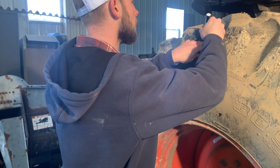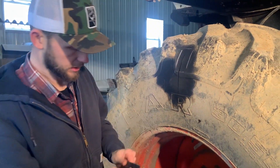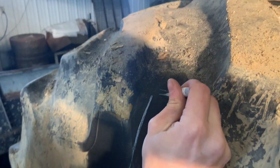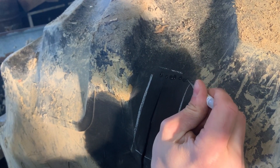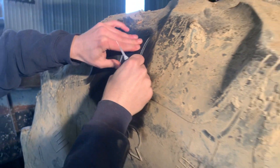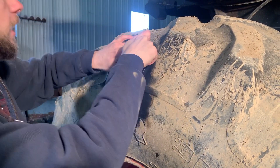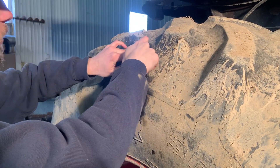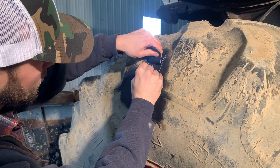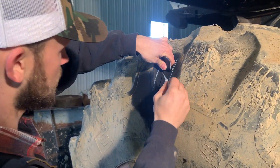I'll just come around that so I know about where I'm going to put that piece as I apply the patch. You can see that it all fits inside. Now I'm going to start up top and just put drops of adhesive here along the top of where this is going to set, then put this here, make sure it's lined up, hold it down, and then come back in and do another piece. You want to hold that for a few seconds between each application. You do want to make sure you do it in drops and not just smearing it everywhere — the drops do make a difference in the patch staying on.